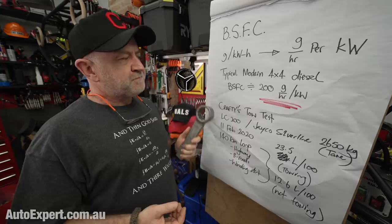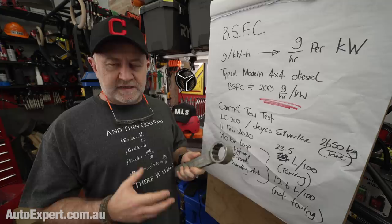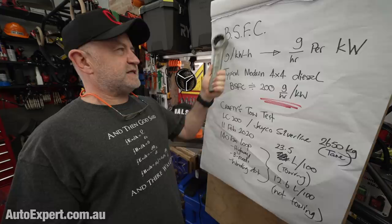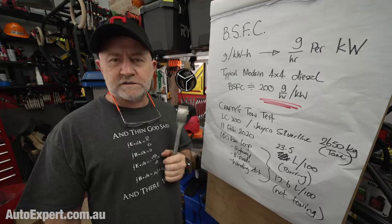It's a relative measure of efficiency. If an engine can be designed that only has to burn 190 grams of fuel per hour for every kilowatt it produces, some mad engineering voodoo has made that engine more efficient. Engineers use this kind of thing all the time — they just talk about BMEPs and BSFCs, it rolls off the tongue, and everyone else just watches it like tennis and hopes to get the number of the bus that hit them.